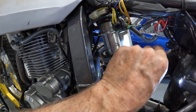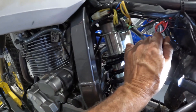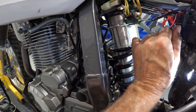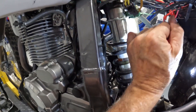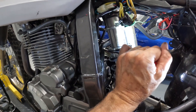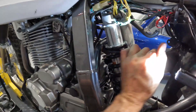They seem to come from the factory with about 18 to 20 kilograms of preload, which is just a couple of millimetres. The c-spanner isn't quite the right one but it's gripping the teeth fine, so I'll just slacken that all the way off and then whip the shock out. Any c-spanner will move it with its factory setting by the looks of it, because there's hardly any preload on this.